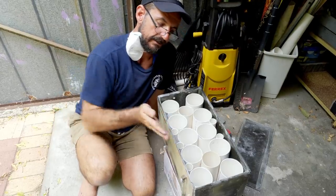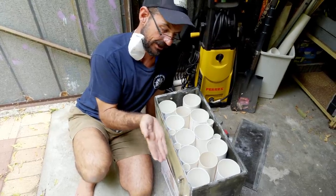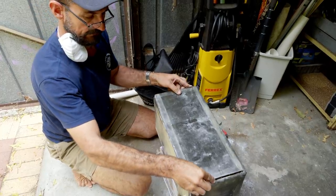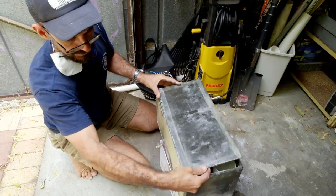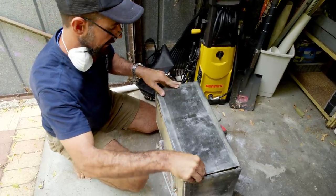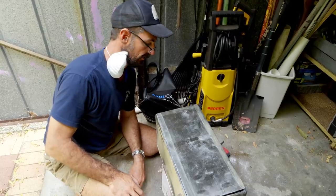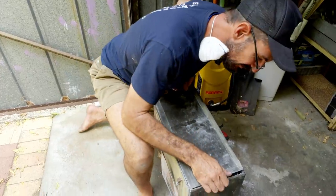I'll just say one thing about the cut — these cuts aren't 45 degrees, they're any old angle. But now when I come to re-glass this lid on, if I'd made straight cuts it would fall down to the PVC, but now I should be able to maneuver this in. I'll backfill it with thickened epoxy and do it with fiberglass tape, and it should be just as strong as it ever was — maybe even stronger because there'll be a thicker fillet through there.